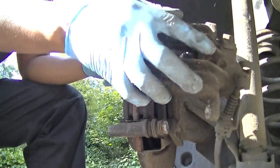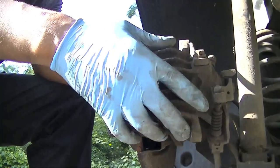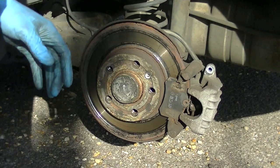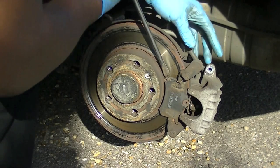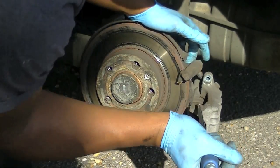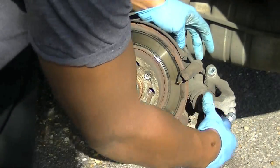It's all very simple stuff. It might be a little bit tricky lying down but it should be alright. Once it's loose, take it out by hand and pull the caliper off. It might fight a little because the piston is compressed, so just use a screwdriver. Then knock off the brake pads on both sides — see how they just come off.